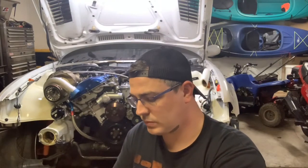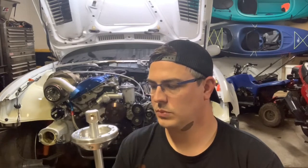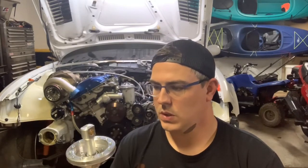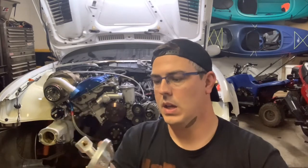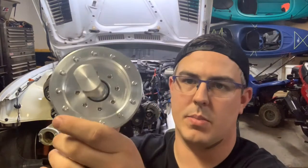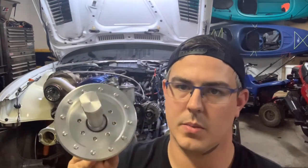With the solid mounts, this four-mount shifter, and the double shear selector rod, you don't need the carrier that comes in the car from the factory. I'll give it an honest review once the car is actually moving — or even just once it's installed as far as the feel goes. One concern is longevity over time once it gets wet, because as you can see it's got a pivot ball in there, and once installed there won't be anything protecting it from road grime or moisture.